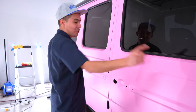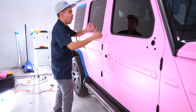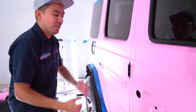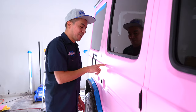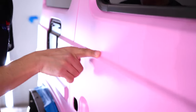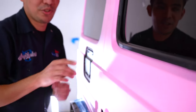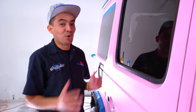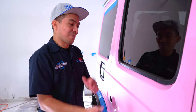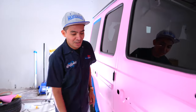This vehicle also has hinges on the sides that kind of pop out — we have two more here — so when I'm doing this it becomes super tricky. Working the material all the way down, the further down you go the more difficult it gets. What's happening here is I got a little bit of bubbling on this line. Normally you're supposed to feed the material and never bridge it, but I got bubbling. It requires me to redo this door — even if I heat it and press it down, there's a high chance it will come back up, so I'm going to rip the door off and redo it.